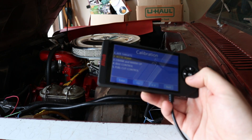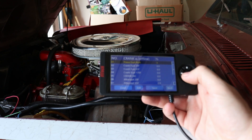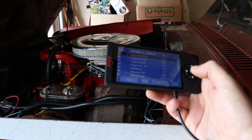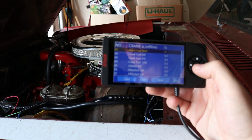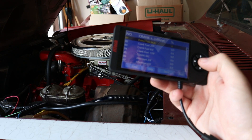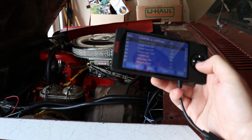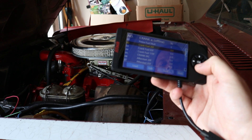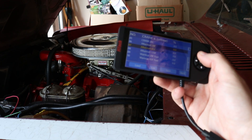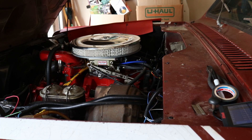All we did was change this prime fuel, which is the initial squirt of fuel it gets when you turn the key on. We backed that down to 190. I may try going down maybe another five or so and see if it makes a difference. If you need to adjust how much prime fuel you get at different temperatures, you have that ability here — you've got crank fuel, then after-start warm-up fuel, all this stuff can be modified off that primary prime squirt setting. So right now it's all just been kind of idle tuning to this point.